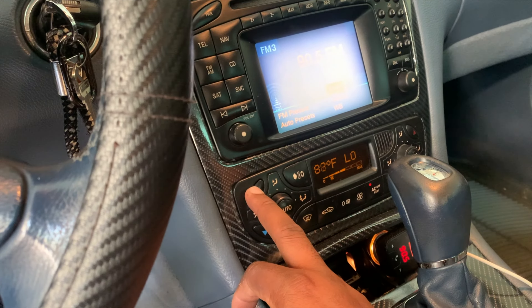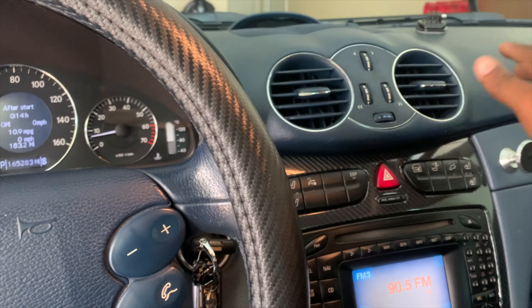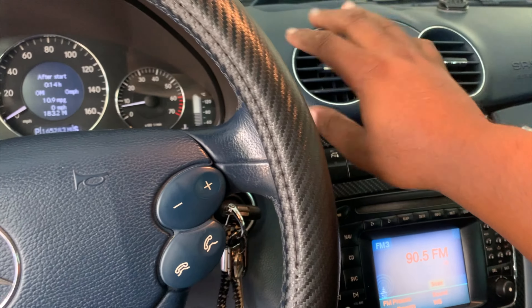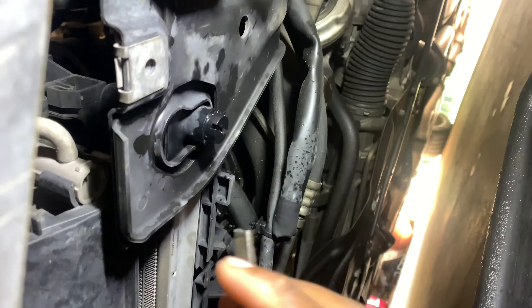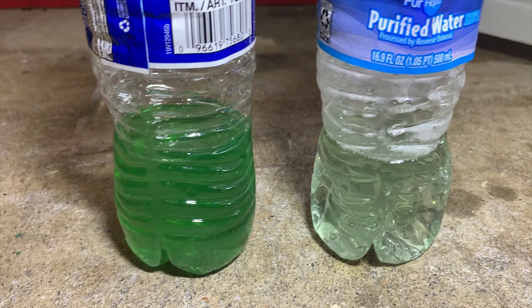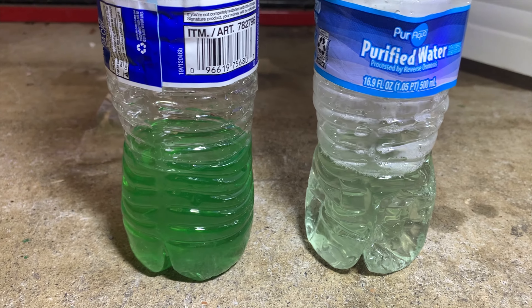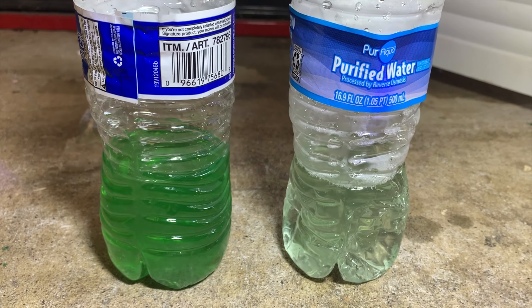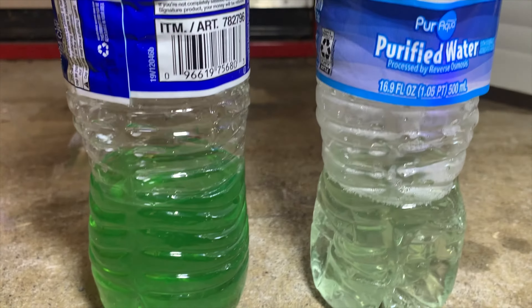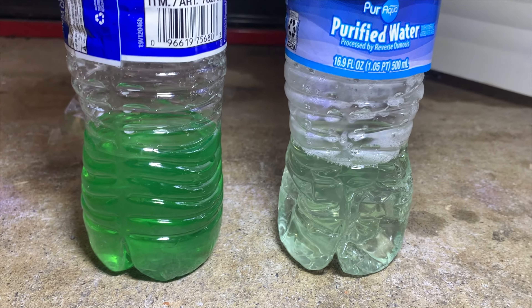I'm going to hold this so it goes all the way to high. If you're not getting hot air yet, give it a little bit of throttle to help it. Once it's already hot, go ahead and turn off the car and repeat the same process. Let's see what comes out this time — it looks like we might just have to do one more pass, maybe two, and then we should be good with adding new coolant. That looks fairly clear and clean compared to the first one, so I'm curious to see how the third one will look.